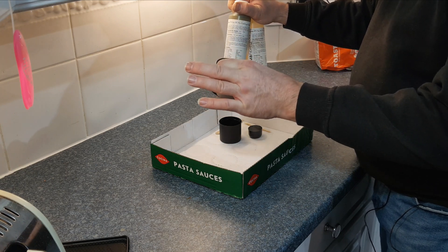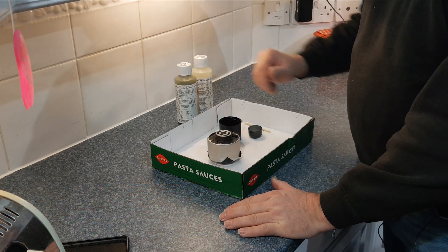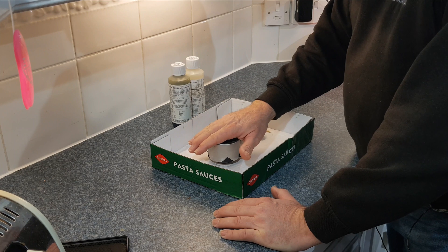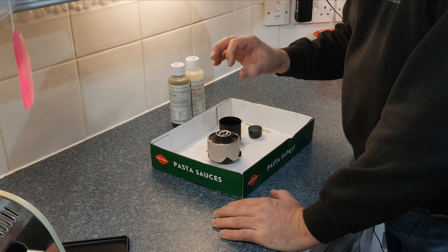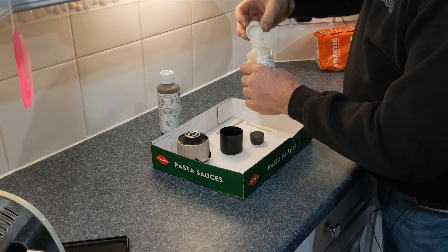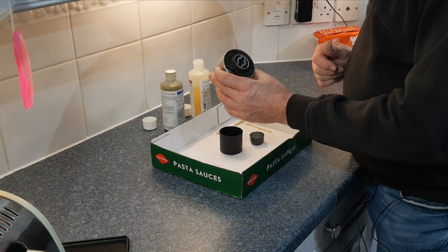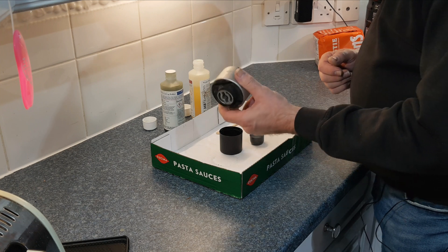Keep your casting rubber and your new bush in the same place in the house, somewhere averagely warm. It's important that mixing and pouring is done at room temperature. I'm doing this in the kitchen because it's cold outside — only about two degrees C, which is way too cold. It's also important that the rubber and bush are at a stable, even temperature, because shrinkage occurs when temperature changes during the setting process. I'll link this rubber in the description. I'm using the 85 grade, which is the hardest available, but you can get it down to about 40. Standard rubber bushes are around 40–50 Shore; the well-known purple PU bushes are around 65 and their black counterparts around 90.